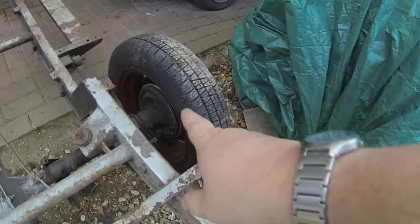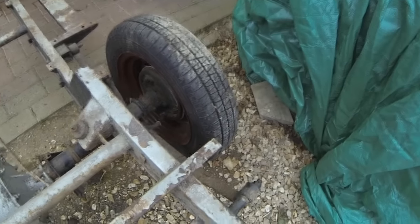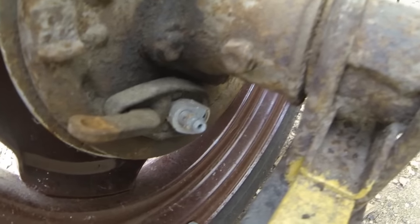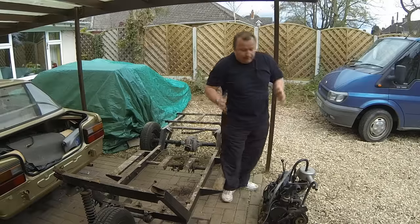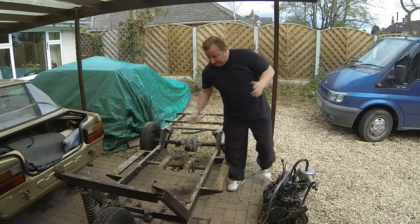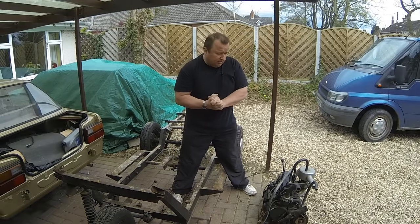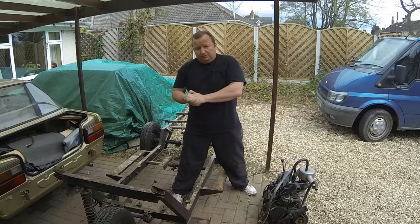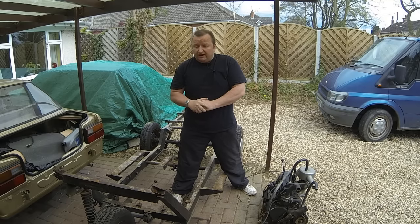Remove the wheels — obviously the brake plates have got to come off and be cleaned up. I don't know whether it's got new wheel cylinders in there, but they actually look pretty new, to be honest. The wheel cylinders do look very, very new, so there's a good chance they've all been replaced. I'm still toying with the idea of the engine. One of the chaps who does Reliant Regal refurbishments has left a couple of messages saying he'd be interested in this seat, so I'm looking at putting black seats in this van to mimic what we had in the original Trotters van.